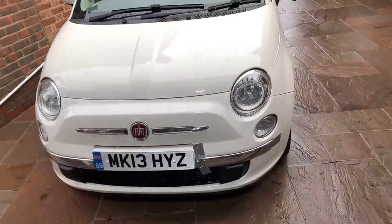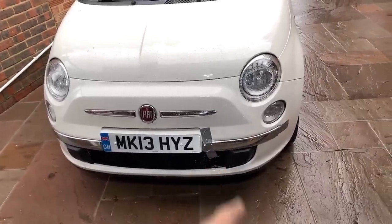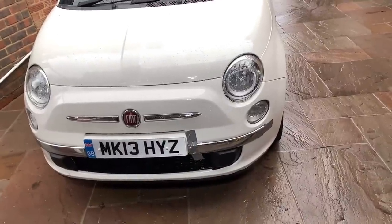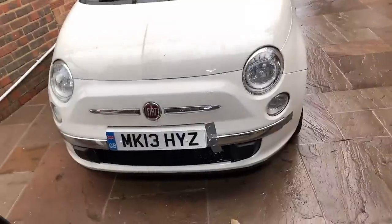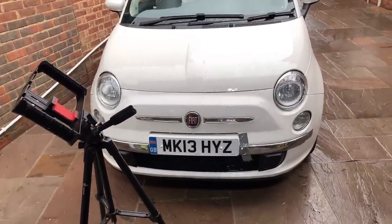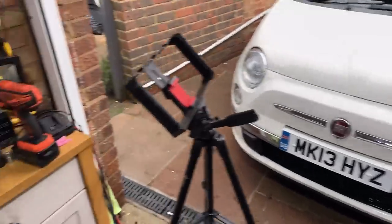So if you find a pop bumper and you can't find a lounge bumper in whatever colour you're trying to get, buy it, and then do what I've done and cut the tabs off, and then just use a resin glue and some of the self-adhesive trim tape as well, and stick it on. I've done it many times before, and with those as well. It works well. So yeah, another top tip for the day. I'm going to leave it another 40 minutes and we'll come back.